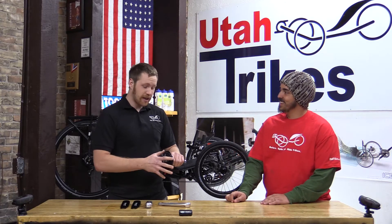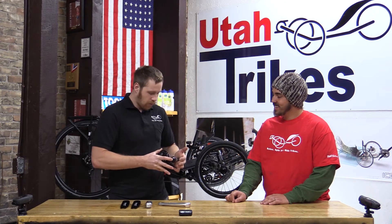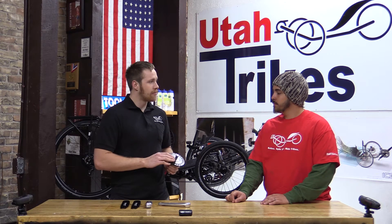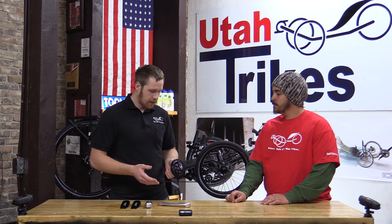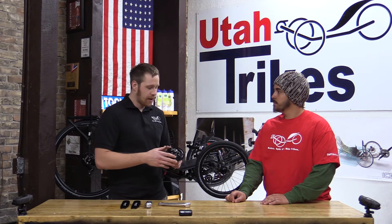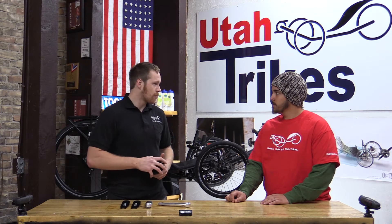What? Yeah, it's pretty high. Basically what we'd use this for is with the 20-inch wheel on the back of a trike, you lose a lot of high gearing. So the Schlumpf kind of helps you recoup that gearing that you've lost. Also, a lot of times we'll pair it with an internal drive in the back, and then you can change cogs there and really tune the gearing for what you're going to be doing.